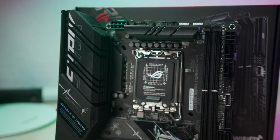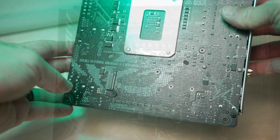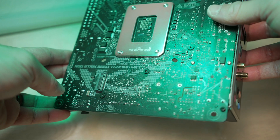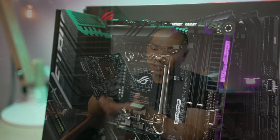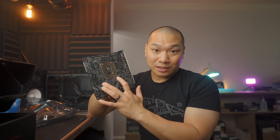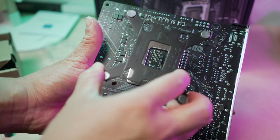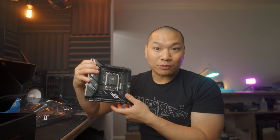The rear I/O shroud is still really big, but the M.2 heatsink is low, which is great. The other M.2 is on the back — I love it. Both of these are PCIe Gen 4. The board also has legacy cutouts for your previous-gen Intel cooler mounting, so your LGA 115X and LGA 1200 mount. But it also has the LGA 1700. I'm going to go ahead and mount my U9S with the LGA 1700 bracket since I have that, and we'll test how that differs later on. Let's take a quick look.